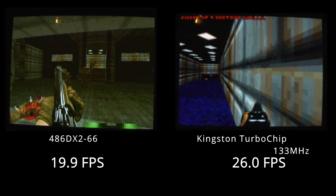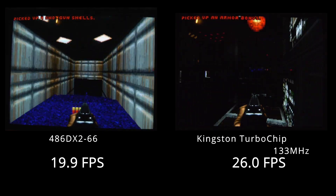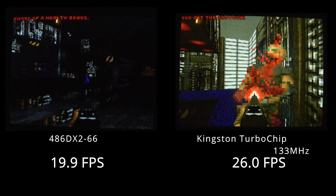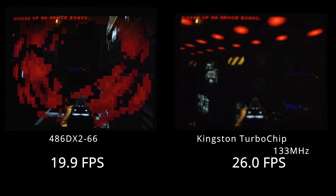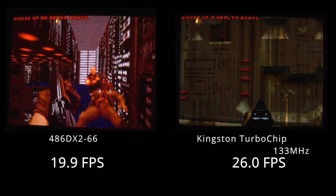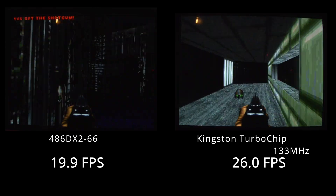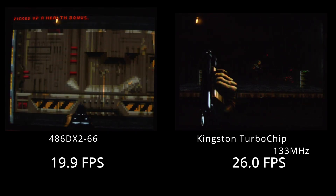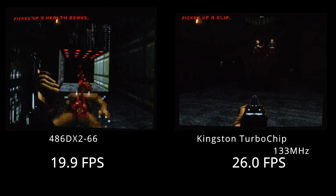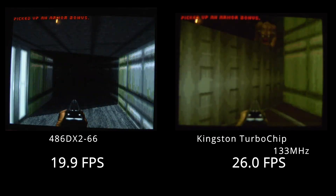Clocking this down to 33 megahertz would significantly degrade performance on the system. So instead of telling them to throw the motherboard away, put a 66 in there, put a 133 in there. These upgrade chips, while not super common, they are around. The DX4100 also exists. There are also still surprisingly cheap interposers that you can put between the chip and the motherboard that will allow you to run these faster 133 megahertz models on a 5-volt motherboard. The I/O is still 5-volt tolerant, just the core is not — so you need that 3.3-volt regulator to make it work if your motherboard's not equipped with it. It's a significant increase in performance.